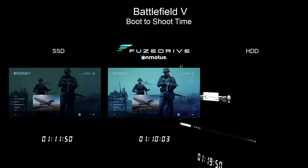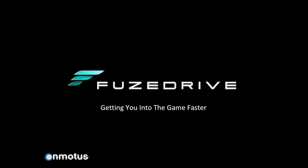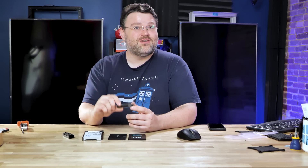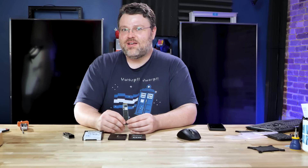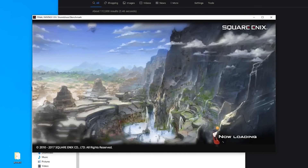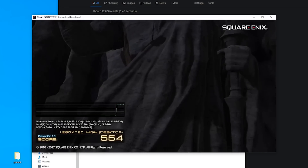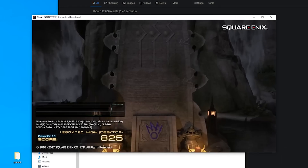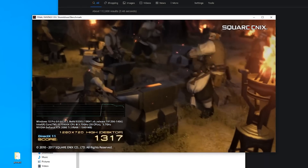When I say five petabytes written, I really mean about 3.6 petabytes written — that's the worst-case scenario according to the JEDEC testing standard. But real-world testing using Anvil is like 6.8 petabytes. I've been banging on this thing for a few months, helping squash and discover bugs — and I murdered one unit, so it died so yours could live. I always like accidentally and purposely murdering hardware — it helps find those edge cases and corner cases. I've got another production model running in PCMark and a whole bunch of other things, and performance is very consistent. Even as the drive fills, the software works really well. I'm on a final beta of the software — there are a couple of things I'd like to see changed in the final release.